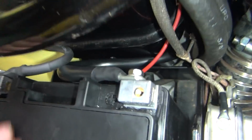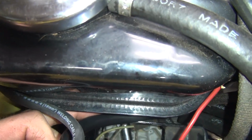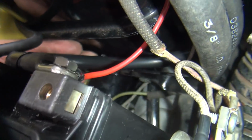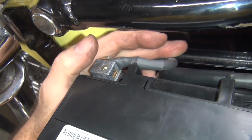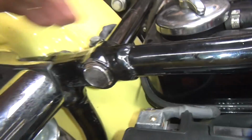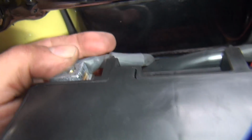So the two cables are over here. The positive cable's right here going around, and then the negative's over here, goes across the top right here. And we got plenty of slop right here. We can put this anywhere we need it over here. So it makes just a big S-curve. That takes the load off this terminal right here. You don't want to bend it right out of the terminal, so we got room here to expand it.